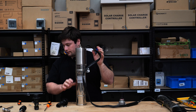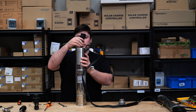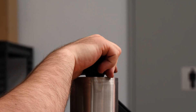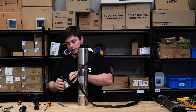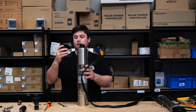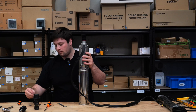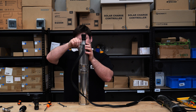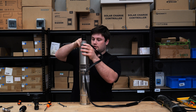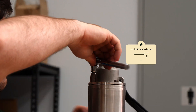Step twelve: finally we want to put all the top stuff back on. The pump housing of the screw — we're going to put that back in here. If this is a little hard to put on, it is worth lubricating; you can use cooking oil or a bit of dish soap. This just allows the screw to turn again — if it's left for a long period of time without lubrication it can get stuck and start splitting the housing. So now we've got that in, we're going to clamp it down. Try to put it back on the same way as before. Get your spring washers and bolts, put them in all of these, and try to do this up evenly just because it's clamping down on that housing — ideally you want that to be relatively even. You can use your 10mm socket to tighten these back up.